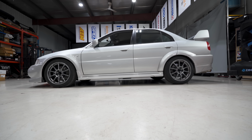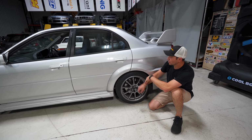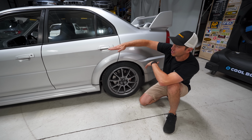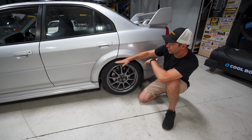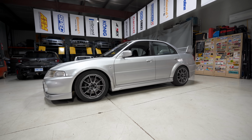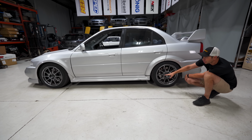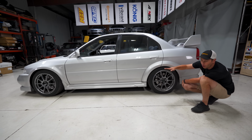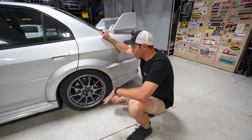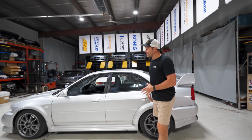That being said, we set the wheel gap properly all around, but what's happened here is, the way these arches are made, they just have a lower profile. So what we need to do to get this car to sit a little more level is lower the rear, which is what I'm going to do right now, and let's see what it looks like. You can see the rear is now significantly lower from a visual standpoint, from the wheel gap. However, if you look at the actual rake of the vehicle, it is almost all but gone. It's still there just a little bit, but it's way better now than it was before. Small little detail, but I think it certainly fixes the overall look, and man, does this car look good.